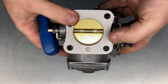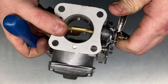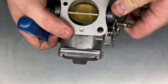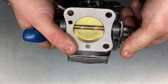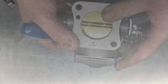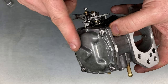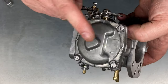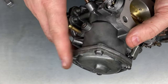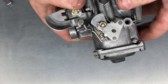One of the more obvious features as well — if the carbs are fitted with the overrun valve with the great big spring-loaded poppet valve in there, on all the rebuilt ones I do I omit that, so I'll give you a nice plain throttle disc. One of the other things to check when you're doing these carburettors is when you're rebuilding them, make sure that you set the float height. These carburettors need the float height setting inside there — I'm not going to show you on this one because this is already built, but it's always shown in manuals on how to rebuild these.